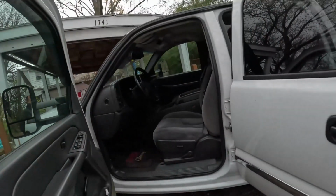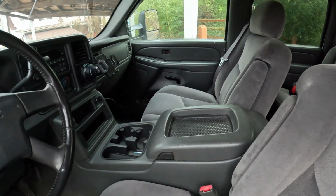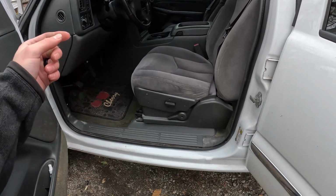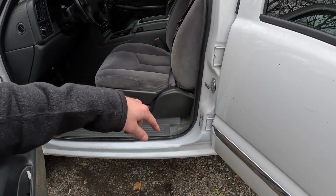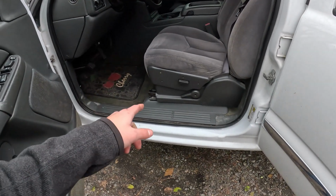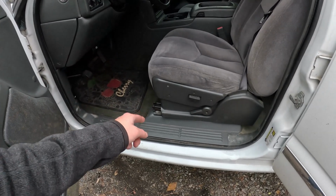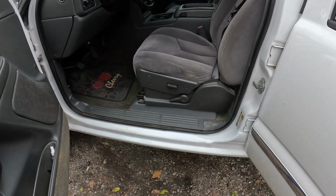I have the seats totally installed, so let me just show you quick before signing off. This is how it looks, which is absolutely awesome. It looks so good. So the front two fasteners are nuts, the back two are bolts. The back two are the E-series and it's the E14. The front two are larger and I did not have the right size. I actually used a 15 millimeter 6-point socket and that worked.